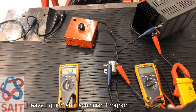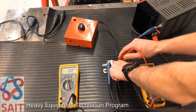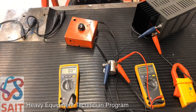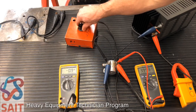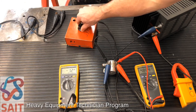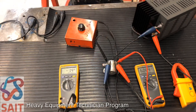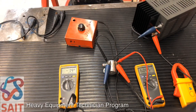Grab the other multimeter and turn it to volts DC. We'll feed it into the alligator clips right here — that'll give us a read on the voltage we're sending down. Turn the power supply on, and now we'll turn the carbon pile until it reads six volts. Do this fairly quickly but without panicking. Get it to six volts and then read the amperage going through the coil — 1.4 amps. This tells you how much current is going through the coil and allows you to properly test it.